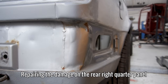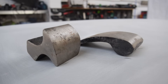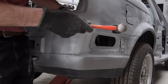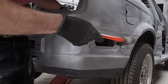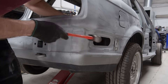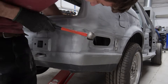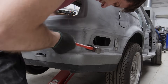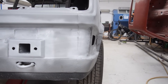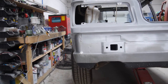As for what is technically the rear right quarter panel, this corner has definitely had a bump at one point, so I'm going to use these dollies and a hammer to try and mould it into a more factory shape. This is definitely going to take some hammering. After the first pass, it's definitely looking better and more like the other side. The main kink is mostly gone, but I still think it needs more, especially around the top and bottom edges.